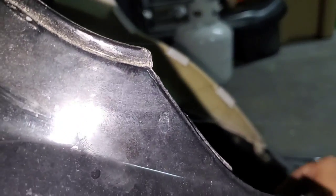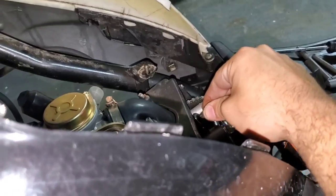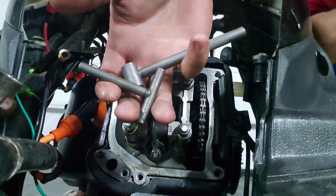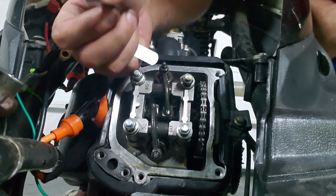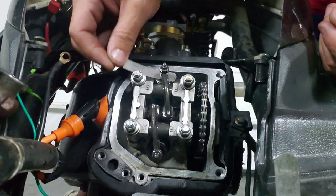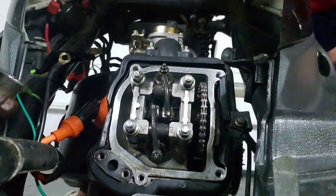These are a little too loose - way too much tapping going on here, that's why these are chattering so much. Intake, exhaust - you can order these awesome little tools. I've done a lot of videos on doing valves on these. I don't care if it's a 150 or a 139 QMB 50cc, I always set them to 0.004 intake and 0.005 exhaust with the feeler gauges. As you can tell there's a lot of slack in here - this should not be able to move this freely, there needs to be some grab on here. This valve is way too loose and it still has a lot of travel, so if you're wondering what all the ticking and chattering is, these valves should have been done a long time ago.